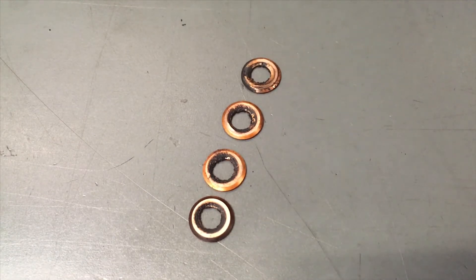All the seats you need to use under these injectors are copper. It needs to be soft so that it can flex and squash to make the seal — that's what a gasket's designed to do. If you've got a hard material like alloy or brass, it's not going to work. These older copper washers are what was traditionally used under diesel injectors generally. There are some applications that use brass, but in these vehicles, that's what's used and that's what needs to be used.